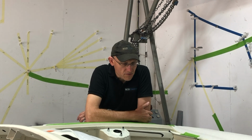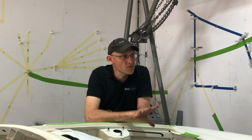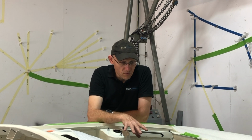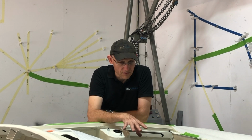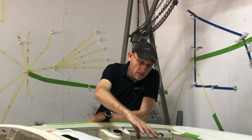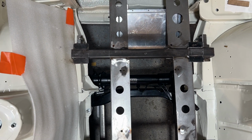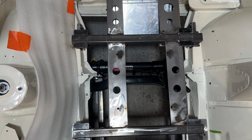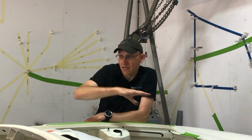Yeah, so I think the most crucial thing is that we've got a package for everything now. There's a few little bits that we haven't sorted with modules and that sort of thing, but they're pretty minor, right? We've figured out the air conditioning going in. We've built the frame that's going to hold the battery box, the charger and the inverter as a unit, and we've started to put in the rails that we're going to hang the motor on. So I think we've got the big architecture laid out now, and probably in a week or so we'll have the motor in. The battery box is being fabricated at the moment, probably a couple of weeks away. So I think we'll have that whole system in there ready to go.